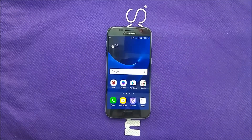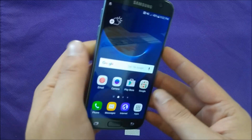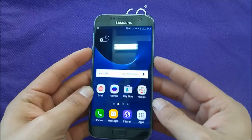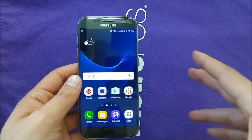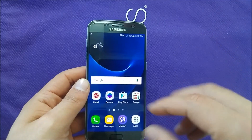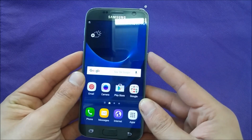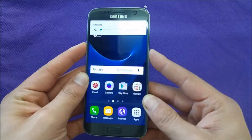You need to use two buttons on this phone: one of them is gonna be the power and the volume down at the same time for about seven to ten seconds. You've got to hold them together. You may be trying to boot the phone and it froze on you, so no matter what the frozen screen is — all you need to do is push the power and volume down, like this.